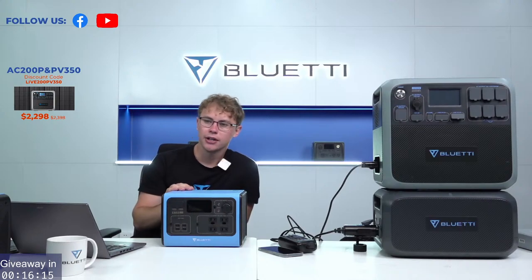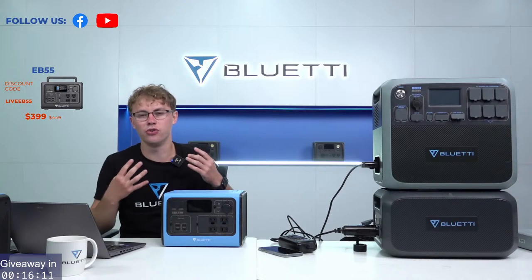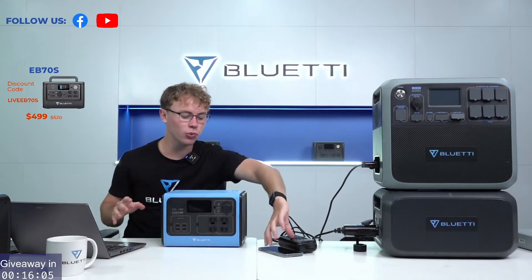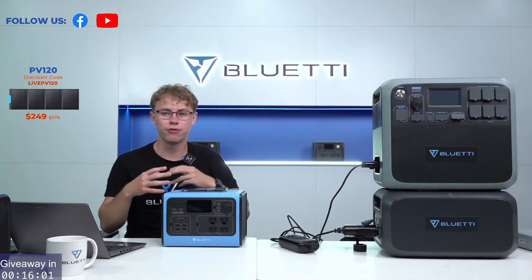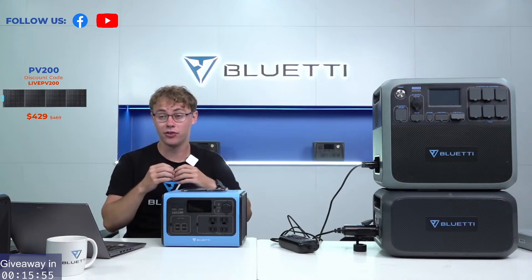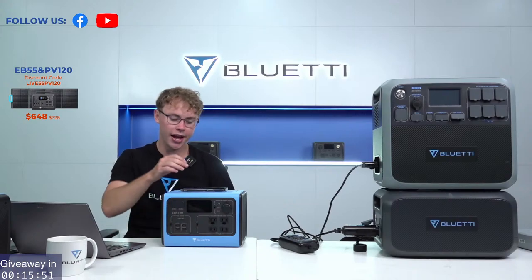Now, if you're trying to save the battery, I recommend you actually use the charger from your phone, maybe a Type-C or USB Type-A. Because when we're using the wireless charging pad on the top, this is the nature of wireless charging pads, almost 50% of the energy is wasted, right? And your phone will get a little bit hot, okay? That's also okay.